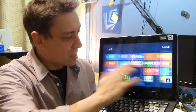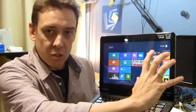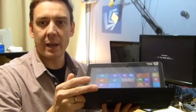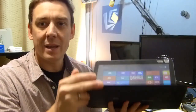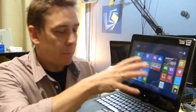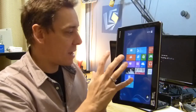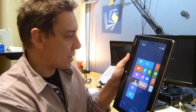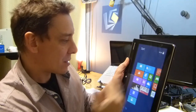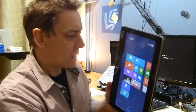The touchscreen here is five-point touch. It is a glossy screen but it's IPS, so you get reasonable viewing angles. I won't say perfect viewing angles because there is a slight drop-off in brightness at some angles, but pretty good. And that's really important because this is a rotating convertible screen — non-IPS screens have different colour balance and brightness on left and right, giving a weird 3D effect in portrait mode.